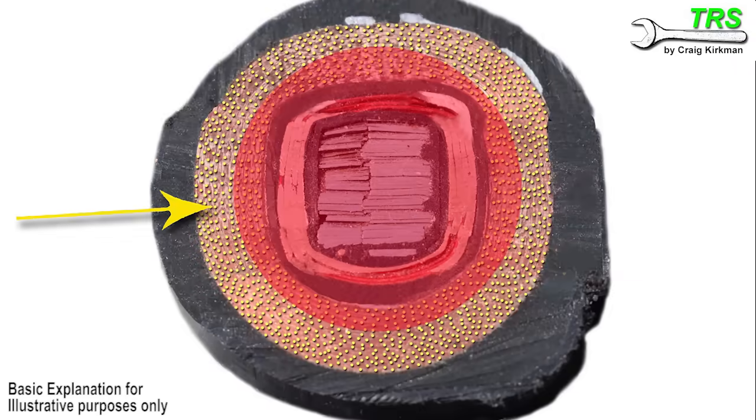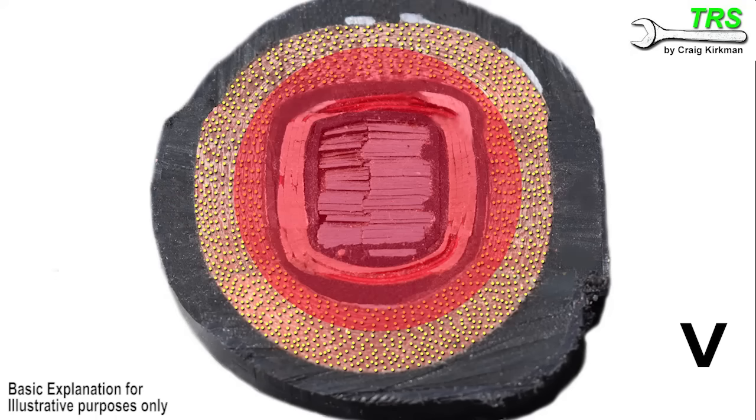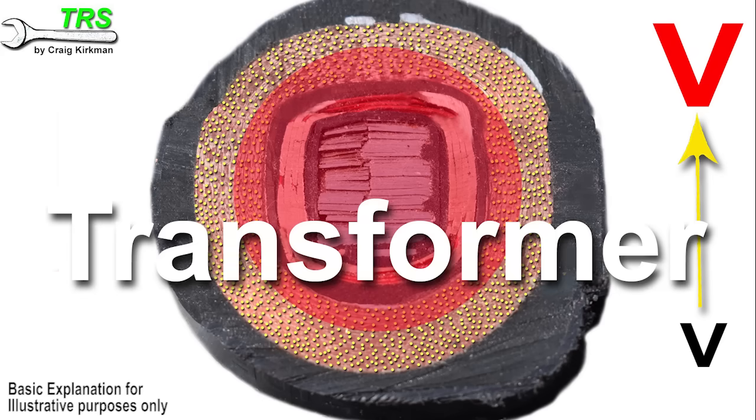Because this magnetic field moved past the coils much faster than the fixed magnet moved past the trigger coil, and because the secondary coil winding is much longer than the primary coil winding with many thousands of turns, this created a charge that went from just a few hundred volts to many, many thousands of volts. Going from just a few hundred volts in the primary coil to many thousands of volts in the secondary coil — where it transforms the voltage from lower to higher, upregulating it — this is known as a transformer.